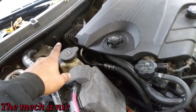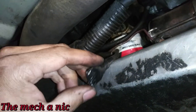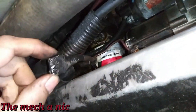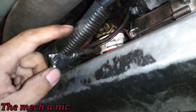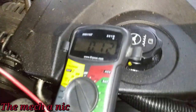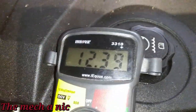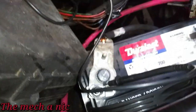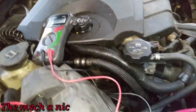Here's that wire I was talking about — I had wrapped electrical tape around it because I wasn't sure where it went. It's clear now that we're missing a power feed to the alternator, so I'm going to reconnect this onto the positive stud for the starter and we should get our alternator working again. Everything is reconnected. I'm going to touch the stud on the alternator — we should have battery voltage. And there we go — I've got my negative on the battery, my positive touching the post on the alternator, and we have battery voltage.